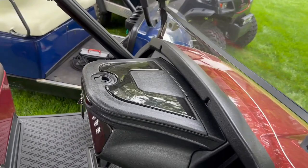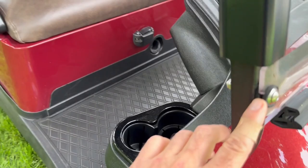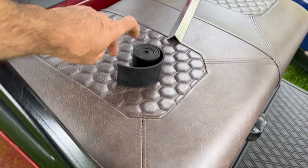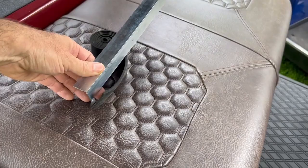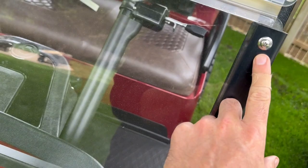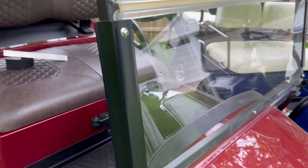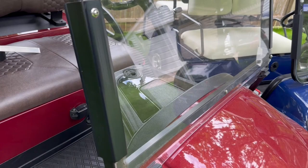I took a little piece of angled aluminum just like this, put a little notch so it would fit, and it's bolted into the factory hole that holds these Precedent windshields. There's rubber sandwiched in between. I put a hole in it in the center to keep it from bouncing, and put a screw here. All of that is to try and silence this windshield when I'm ripping around. But that being said, still in good shape. I haven't buffed this for about a year and a half — I've just been maintaining it with a couple of automotive detail products.